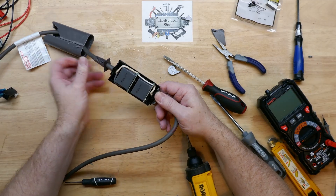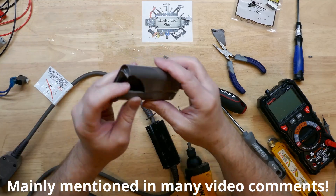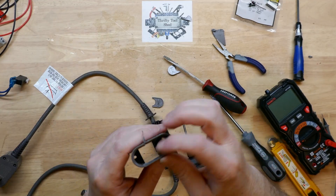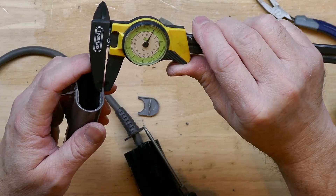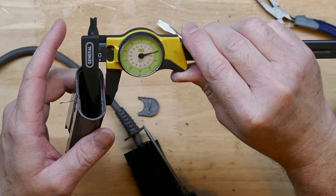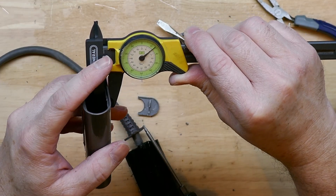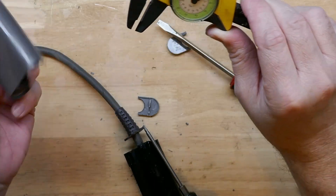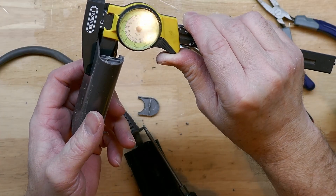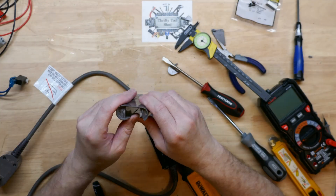This is what people have been asking to see — asking what it is. I mentioned many times that I could run the Dyson with just 120 volts straight on it during testing, so I knew it was probably some type of filter. Didn't know it was just caps. Just look at how thick this housing is — very surprising. The little lip looks like a little over one millimeter as I'll show with these calipers, but going inside we see it's closer to a little over three millimeters. So if you ever have to take one apart, keep that in mind — it's a lot thicker than it looks on the edge. I could have set my blade depth to about three millimeters and made this a lot easier and quicker.